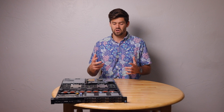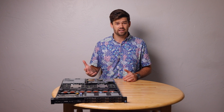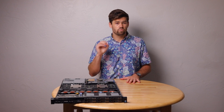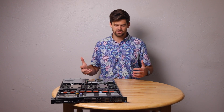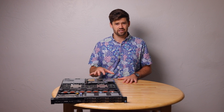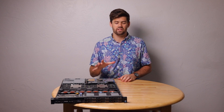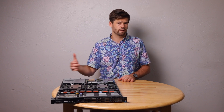That's going to be it for this overview. I've really enjoyed having this R630 in my house, and I think it's one server that definitely is going to be quiet enough for almost any home as long as you don't add any PCIe cards — a great introduction to getting a server at home. When you're looking at getting into this market, make sure to think about power costs overall. I wouldn't even buy something from the 20 series PowerEdge — I'd really go the 30 series if you can, because the 20 series just has so much more power draw. Running this 24-7, power costs can easily add up within a year to be way more expensive than the upgrade, so really take that into account when budgeting for these machines.